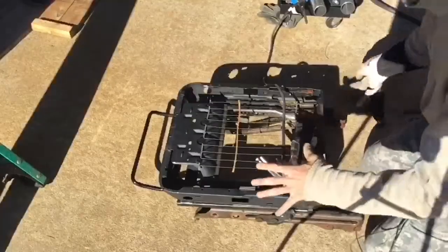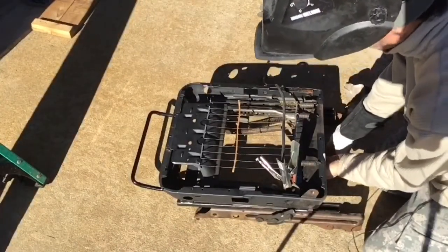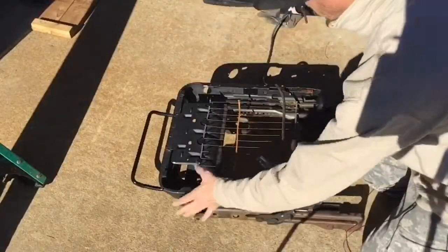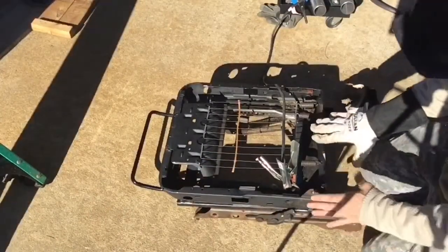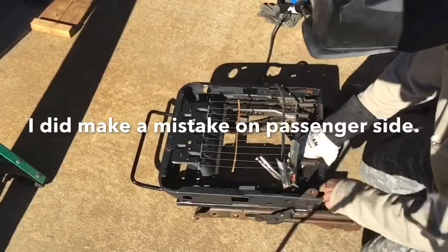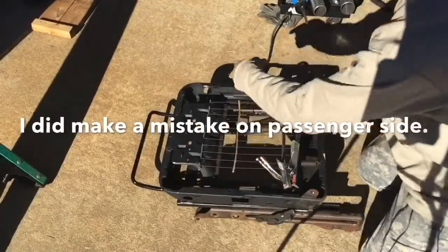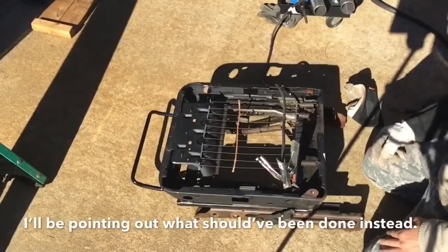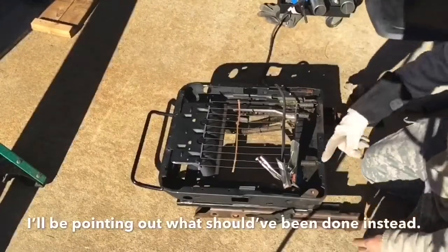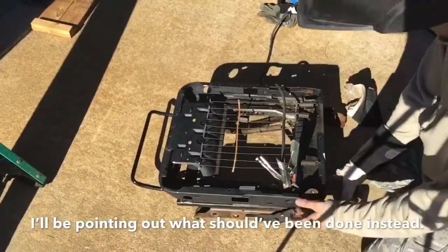All right guys, as you can see, I went ahead and welded the bar to the actual bracket of the seat of the Crown Vic. Now, I took the Mustang seat apart so that I won't catch anything on fire. And you're able to weld from the top where the actual bolt holes are, so it could brace up the bottom of the seat. After I tack welded, I welded on the inside. I'll flip it and make sure I do some good welds around the perimeter on the bottom.